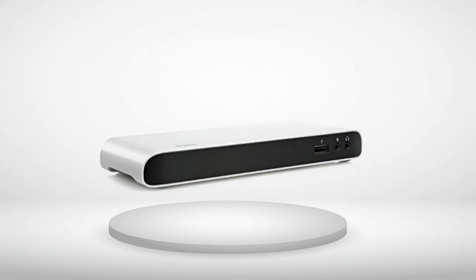Review number 2. The Thunderbolt 2 dock is made of brushed aluminum and black plastic and matches the slick look of the MacBook Pro computers. It comes with its power supply, 100-240V world capable, and a 1-foot-long Thunderbolt cable. The front features a USB 3.0 connector as well as headphone and microphone 3.5mm mini jacks. On the back, power input, HDMI, 2 Thunderbolt 2 ports, 2 USB 3.0 ports and a Gigabit Ethernet socket.